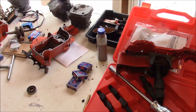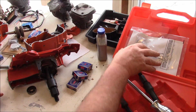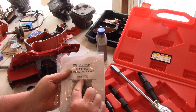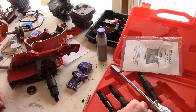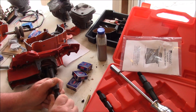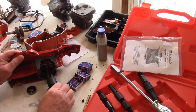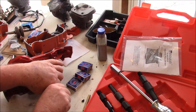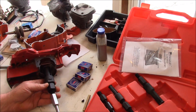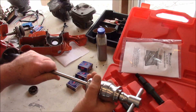I'm going to make another short video — this is another Harbor Freight Saves the Day. I had to buy this blind hole bearing puller set from Harbor Freight, model number 95987. It has these devices where when you turn them in, you see how they spread — they grab on the inside of the bearing, whatever you're trying to pull. Then you attach this to the slide hammer and take out the bearing. That's what it looks like. I've got it turned in there and it's up pretty tight, so at this point I'll put on the slide hammer. The slide hammer attaches there, and once stabilized you take the slide hammer and take the bearing out.